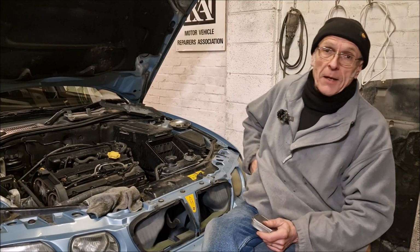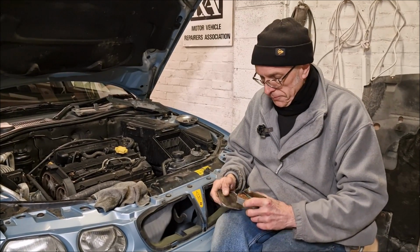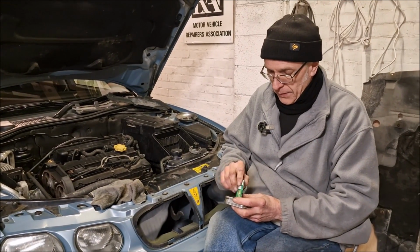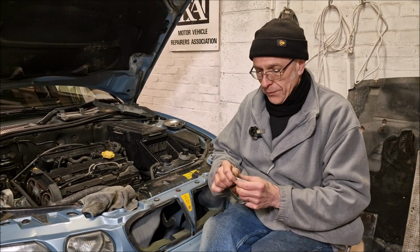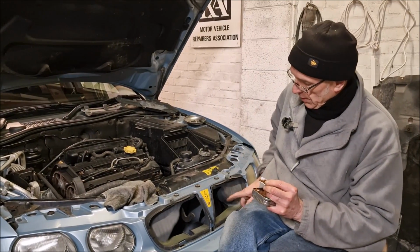Well, we did that special temperature thing, didn't we? Yeah, that's true. And the fan does come on at 105 degrees, like they say. Yeah, so we've discovered, thanks to people on the internet, the onboard diagnostic system, because the temperature gauge in the Rover 75 is either hot, cold, or middling, and it actually gives us the proper temperature of the car. We've had it right up to 105 degrees, and as you quite rightly say, the fan comes on at high speed, but there's still an issue with that fan, isn't there? Yeah, no low speed, mate. Resistor? It's usually that gubbins in there, isn't it?